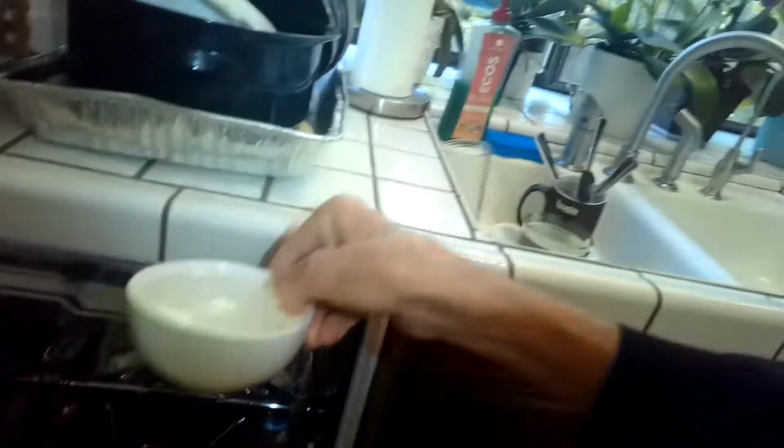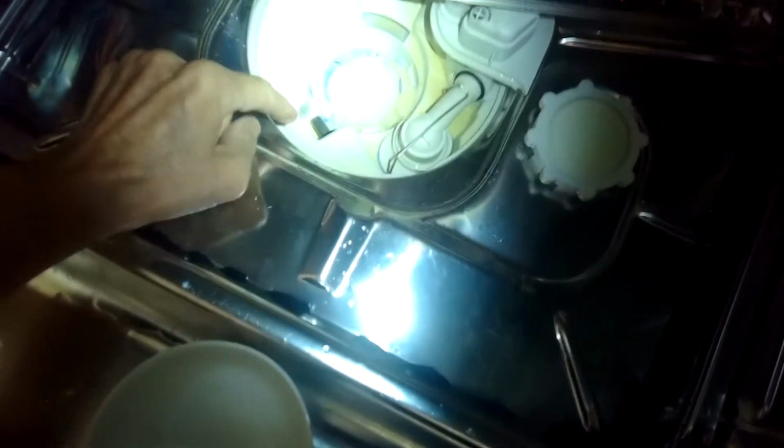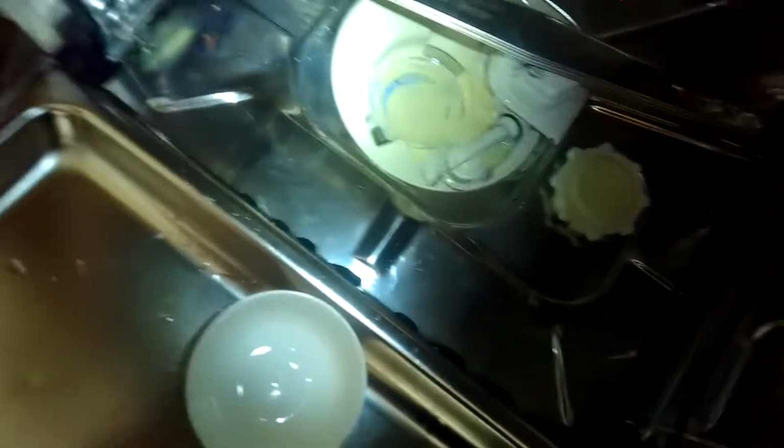So just use a small bowl. You can get a lot of that water out, and we'll use a turkey baster when we get near the end there. Just so you know, when you're working in this area, this is a temperature probe, and make sure you don't push this in. A lot of people think it might be a button. If you push it in, it'll create a leak. So you need to make sure this stays in this position.